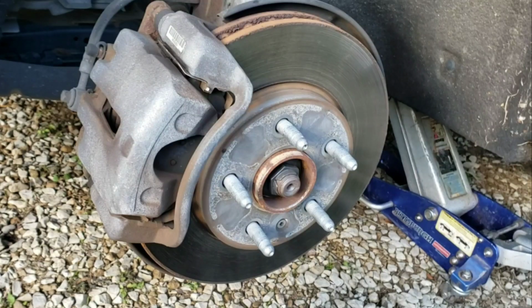All right, guys, I'm going to talk a little fast here because I've got a lot of information to cover before we move on any further. I looked online trying to find torque specs for this, and I couldn't find them. But what I found was more than one claim that these were torque-to-yield bolts, which means, long story short, if you take them out, they need to be replaced because they stretch, or they might not hold like they did originally. That worried me slightly.